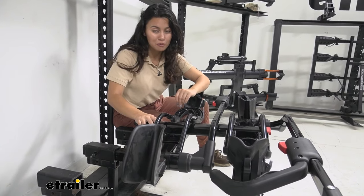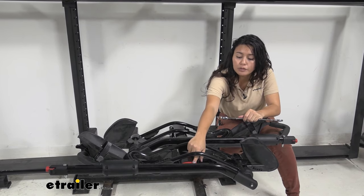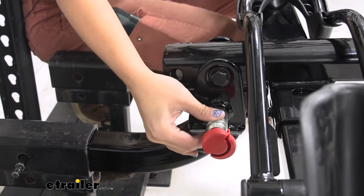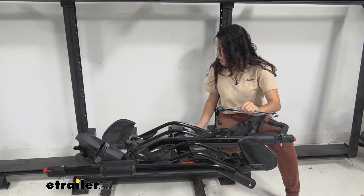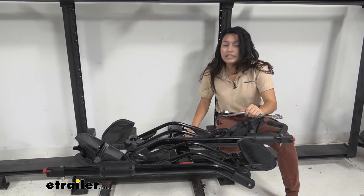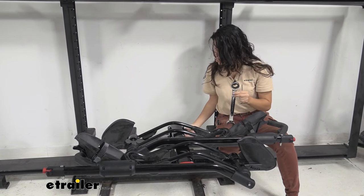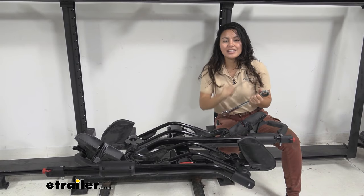What's included with this is the spine assembly — that's from your red bottle-cap opener to the end of the shank — and also the bolt that holds the spine and shank together. What's not included is your bright red and silver spring pin, your anti-rattle bolt, and the tools you need to install. If you cross-threaded your anti-rattle bolt, that's something you'd get separately at etrailer. The tools I use are a 24-millimeter wrench to tighten things down, a spring pin tool, and a hex tool for the spine assembly.